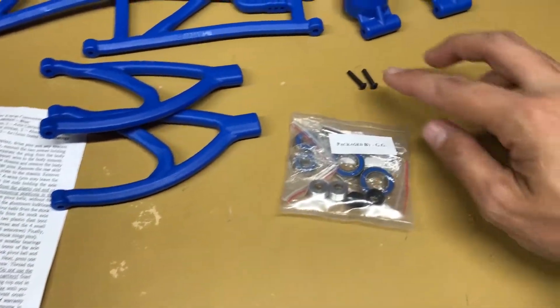I'm partway through — I've got one side ripped off with the stock side still on the other. Up here you can really see on the old one that the toe link controls which way the wheel is normally facing, because if you make it shorter you get toe out and if you make it longer you have toe in. On the True Track you can see it eliminates that piece and basically locks it in place.